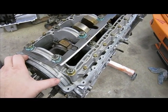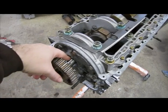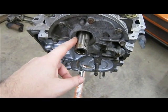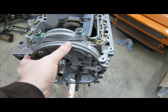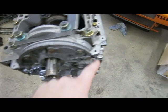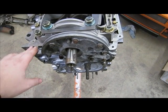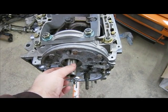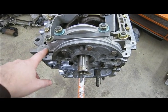Then I take the oil pump off and get everything ready to put on. When I put the oil pump on, I slide on the oil pump drive shaft gear - a little gear that slides over the shaft and interfaces with the teeth of the oil pump drive gear. I torque the oil pump down and make sure everything is completely flat on both sides. I actually used a small flat piece of metal as a guide while torquing it down, so the gear shaft slid right off. That way I know the drive gear will slide on after I have the front seal on, and the oil pan gasket will seat properly because everything is flat.